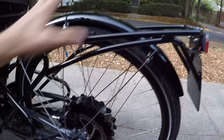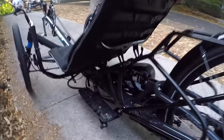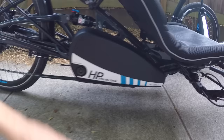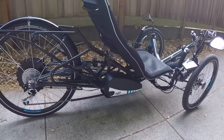I also love that they've got a fender here and this nice standard gauge tubing on the pannier setup. You've got the pannier blockers back here, potential room for a trunk bag. There's a lot of versatility in a bike like this just as a bicycle. But this one really takes it to the next level for being electric — there are special plates here designed specifically for battery packs. The battery is HP Velotechnic branded with a plastic casing. This is 36-volt, 15.5 amp hours — that's really quite large. It's over half a kilowatt hour of energy. It does lock to the frame and is pretty well positioned in terms of weight distribution. You can add a second one, putting you over one kilowatt hour for amazing range.